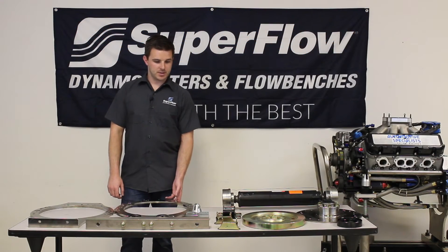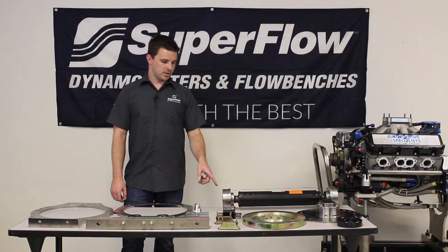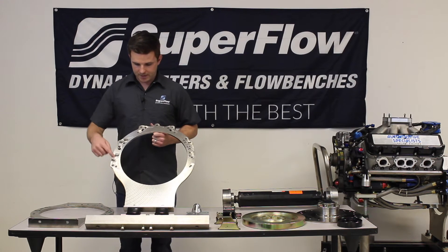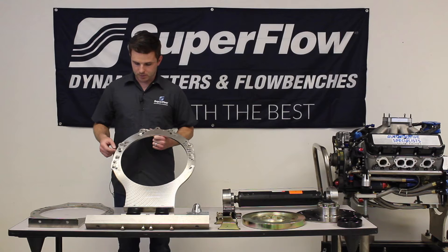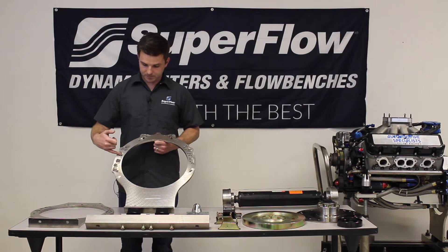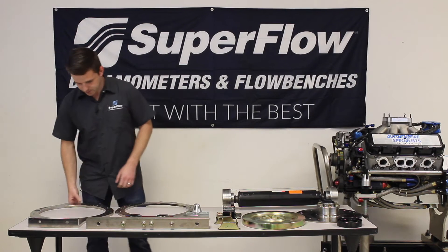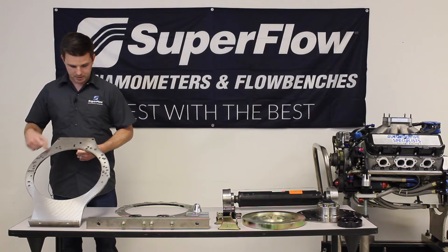We have several different accessories to adapt engines to the engine cart and from the flywheels to the front of the dyno driveshaft. For rear engine adaptation, these mounting hoops — affectionately called 'toilet seats' — have different bell housing patterns. The DT1271 is the universal small block one, covering small block and big block Chevy and the rest of your domestic small block patterns. It has locating holes for dowel pins and bell housing patterns, and you can add additional holes as needed. The DT1272 is the big brother with domestic big block patterns.